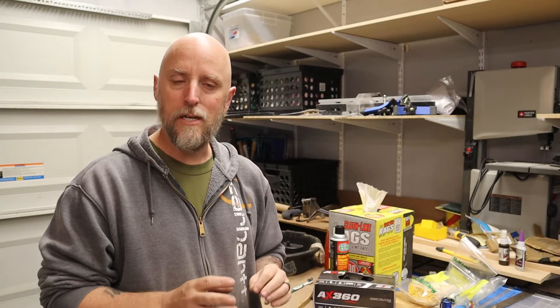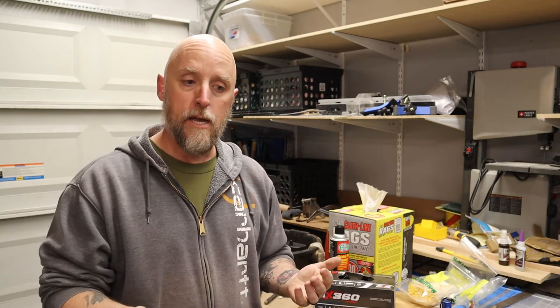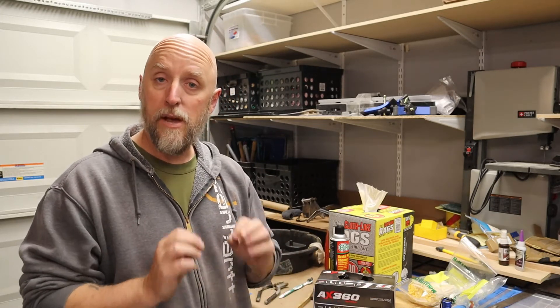But a while ago I was working on an old CJ7 and that engine was horrible. The rear main seal was leaking, the valve cover was leaking — it was one of the plastic ones so that thing leaked like mad. That engine was just caked with grime and grease. So when I had pulled it, I found probably one of the best degreasers I've ever used on an engine or engine parts. I had the engine on a stand with basically a catch basin underneath it, because I do most of my stuff in bins — catch pans. I don't have a parts cleaner, a sand blaster, or a bead blaster. So most of my work is done in bins like this, which is another reason why I try to limit caustic chemicals.